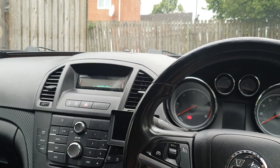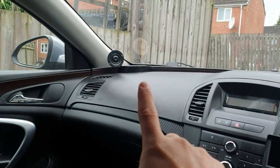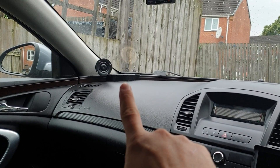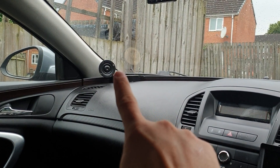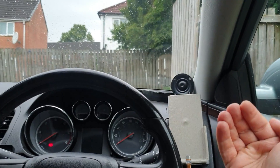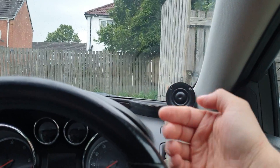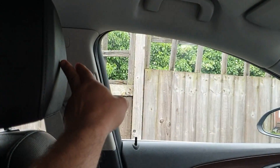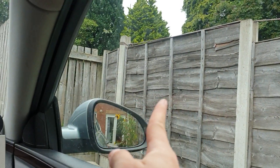My theory about why this is: on my main system the mid-range is firing up the glass and the tweeter is right on axis towards you, so it's kind of a point source. Whereas on the two-way, the tweeters are not aimed towards me — they're aimed like opposite to each other. I tried to aim them slightly towards me but I guess one is aiming toward the headrest and the other toward the glass or the pillar.